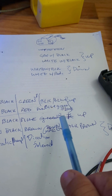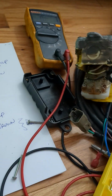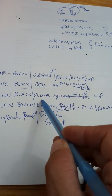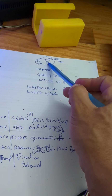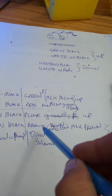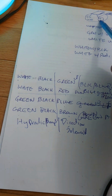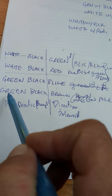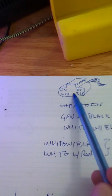In which case, what was going up, what was green here, upper left-hand corner, if I do a connector for this one, this green will now, since it's going up, have to become the blue. And the down, the red here, which is upper right-hand corner, the down will become the brown. And the blacks could stay the same, lower right-hand corner of the connector, and the green of the new will be where the white one was for the old.